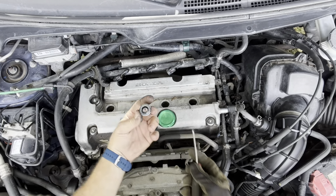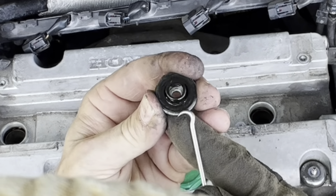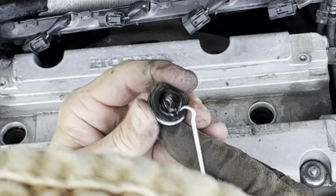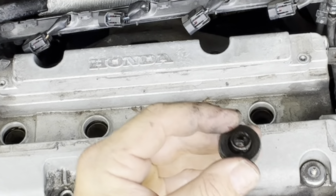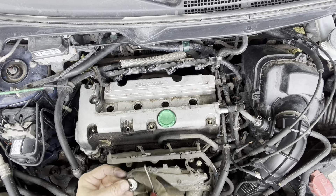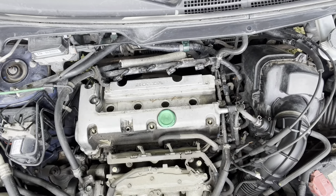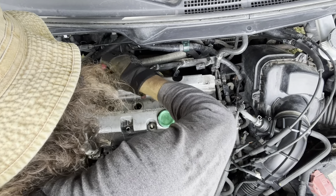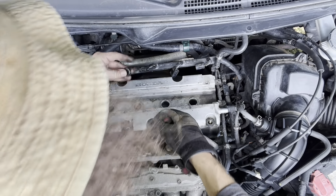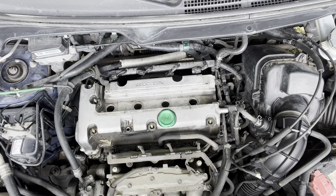There's one of those — I've got new ones. These are very oil soaked, still kind of pliable, but it's cracked. I'm not going to reuse these. In a real bind you could reuse them, but why bother? Some of them are crunchy — the metal came off but the rubber didn't. I suspect the valve cover gasket is going to be as crunchy as those bolt seals.